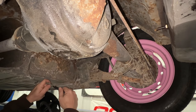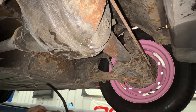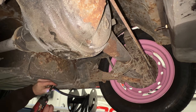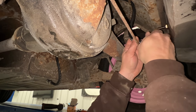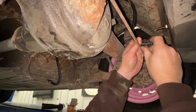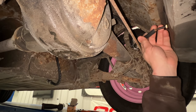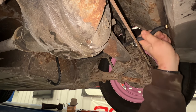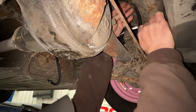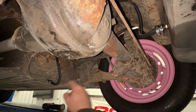I'm going to take some quarter-inch fuel hose and put these two pieces of pipe back together. This hose will be able to clip up into the original clips that the pipe was held up with. I'm putting two clamps on each side — not because I'm too worried about fuel leaking, but if it starts to suck in air from anywhere, the pump and the carbs are not going to work correctly. Making sure it's an airtight seal is very important. Now I should be able to get fuel from the tank up to the fuel pump.